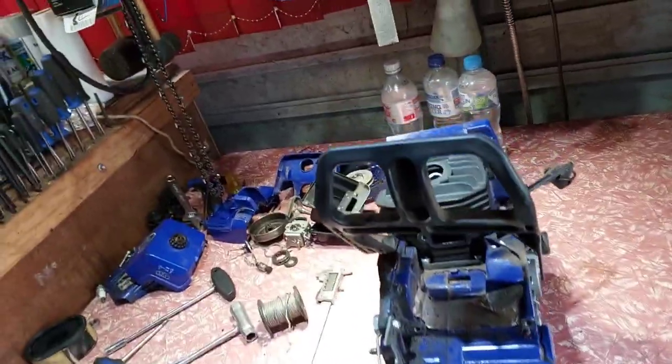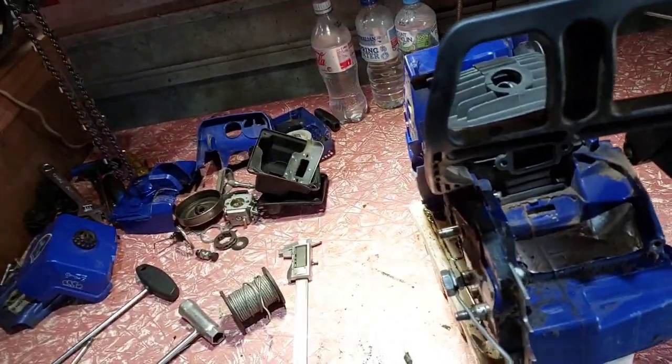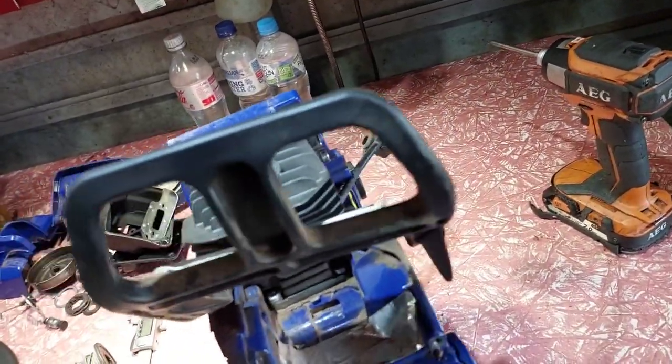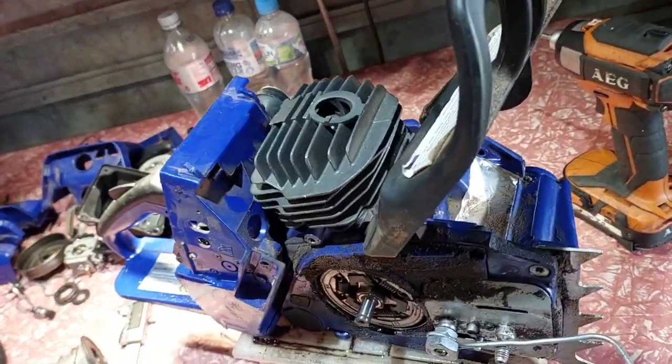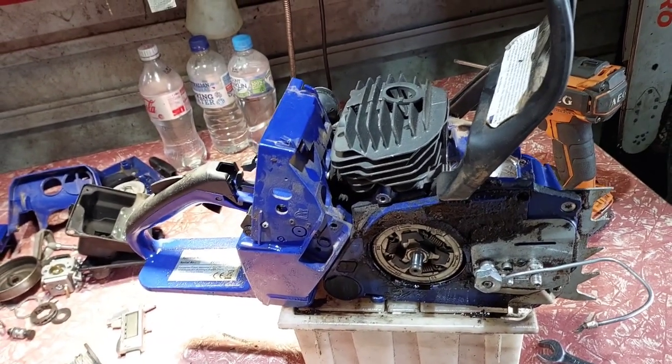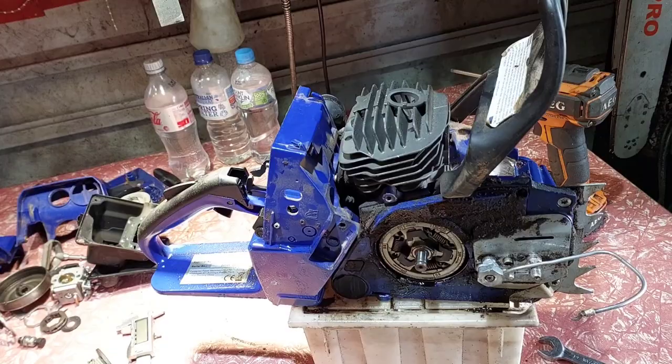Hey mate, here's Aaron's saw and I pulled this one up. I just ran a degree wheel over the saw — I didn't film it — but I was surprised. It's only got 69 degrees opening when it started opening. I thought it would be more than 69.